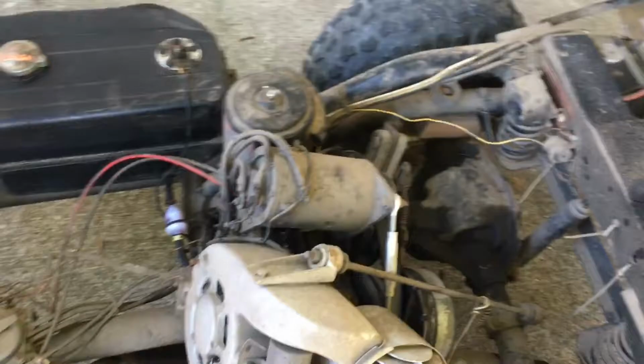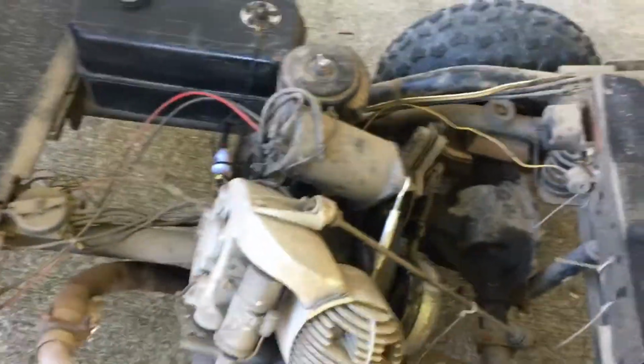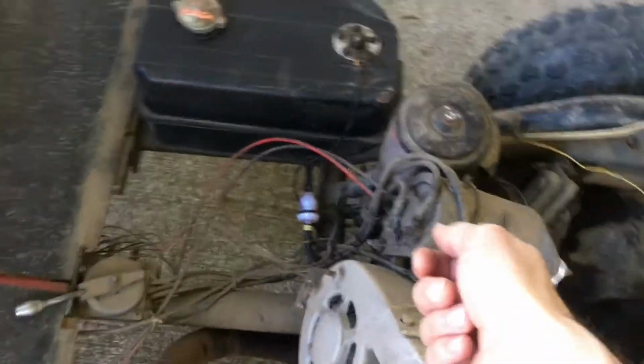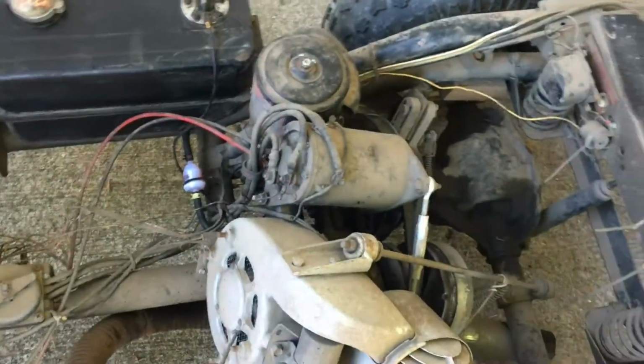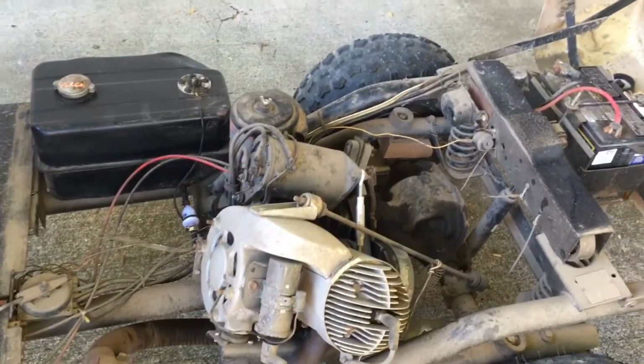The issue is that when the battery's charged, the start motor gets it going fine, but there's no charge going to the battery. The difficulty is that to keep it going, you have to have your foot on there, so it's hard for me to keep my foot on there and put my multimeter on to see if the start motor is flipping to its generator state to charge the battery back up. I don't think it is. So that's what I'm trying to figure out.